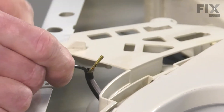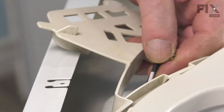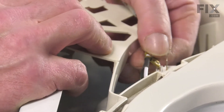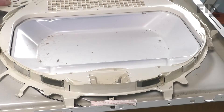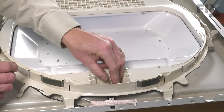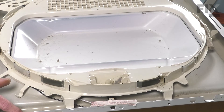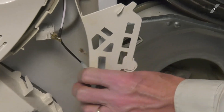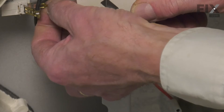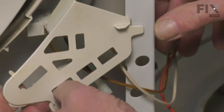Next, we'll reattach that single wire from that harness to the door switch. Make sure that panel is attached securely. We'll tuck that black one back out of the way. We're going to reconnect to the main wire harness. Now that we have everything lined up, remember to reinstall the light bulb. Make sure it's not cross-threaded in the socket. Tighten it finger tight. Then tuck that back into place and make sure that tab slides into that slot.